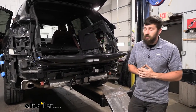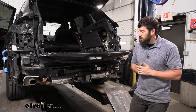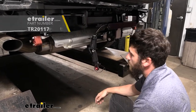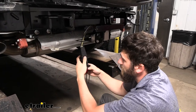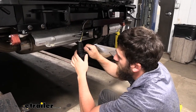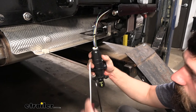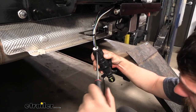Temporarily reinstall the tail lights, plug a seven-way tester into the connector, insert the fuse into the fuse holder, and test all signals — brakes, left turn, right turn, and running lights. Once everything is confirmed working, re-secure the terminal block inside the seven-way housing. There's one screw on the top and one on the bottom — make sure the terminal block orientation matches the picture in the instructions. A screw at the top collapses the grommet where wires enter, helping keep out debris.